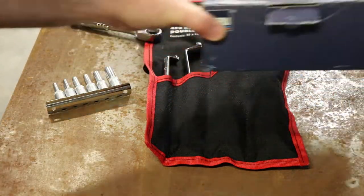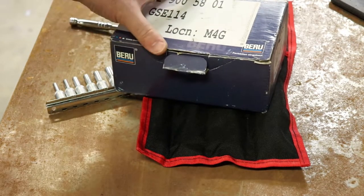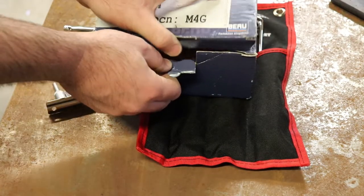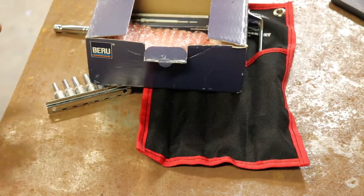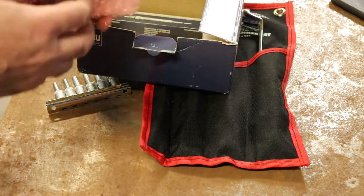You also need to have a glow plug controller. I bought the Beru. I'd recommend going with the OEM. You can get Dorman, but if you're going to do that you have to be very careful with part numbers. You should take the existing one off and check the part number on it before you order the Dorman to make sure it's the right one.